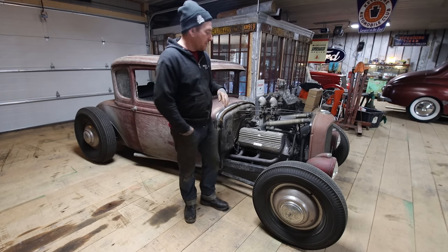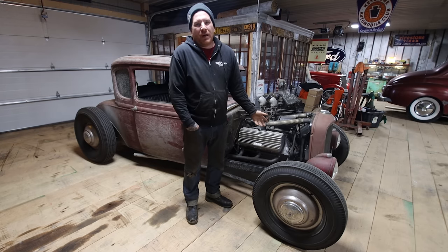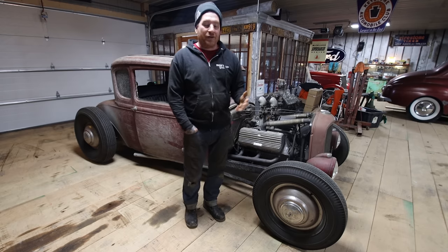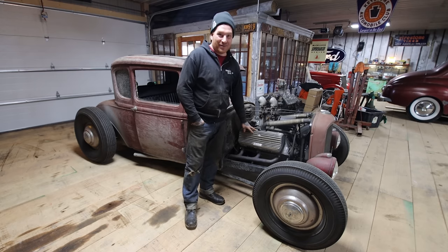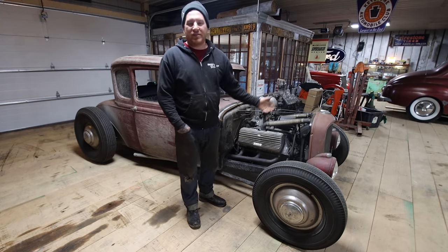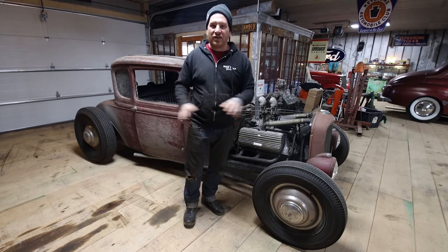For the engine, I opted for an earlier style East Coast bar and went with a flathead — a 24-stud flathead, actually a '41 flat, not a 59AB, but that style. The engine has been mildly modified: bored out to stock Mercury APA type standards. I have a Fenton high-rise intake and Pertronix ignition hidden in a stock distributor, still running the generator converted to 12 volt, some simple headers, and a recent addition — Fenton marine head covers, basically a dress-up item made for boats.